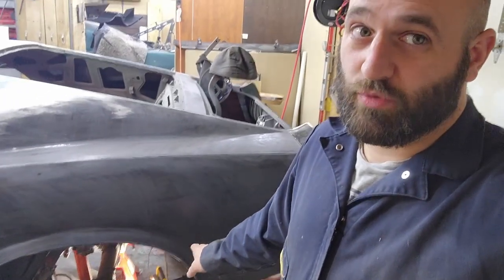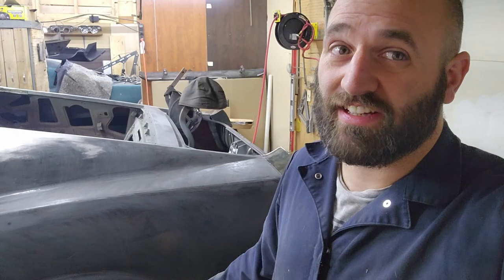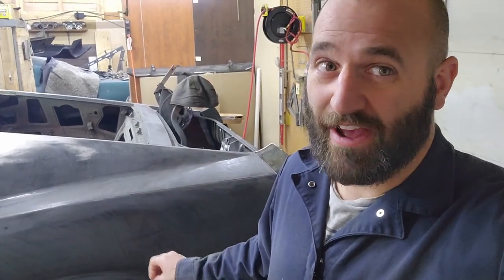And also, one thing to remember, especially with these 8-inch rear ends, is there's usually not a fill hole. So you actually have to fill it through the axle tube. So before you put both axles in, you have to fill the fluid through the axle tube. And for a posi or a Track Lock or whatever you want to call it, true track, I don't know, you have to do it with the friction additive. So we're about to get to it later.